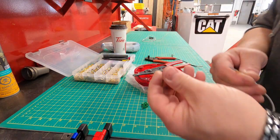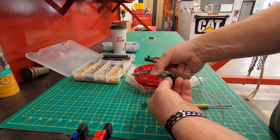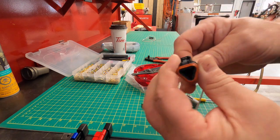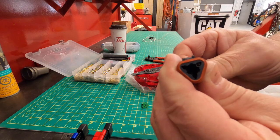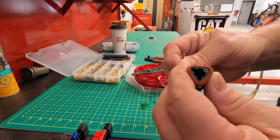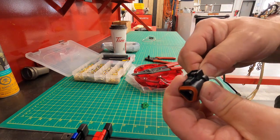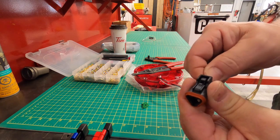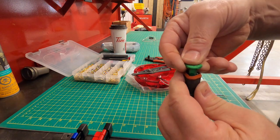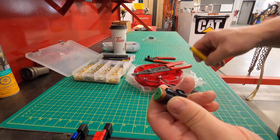To put these together, all you do is find the appropriate pin. It will coordinate these pins to whatever matches here. So the white one goes in this corner — you just push that in until you hear it click. It's locked. Here's one I've done already. The black one is this corner, so push that guy in there and push it in until it clicks. So we're done. After you get all three wires in, you just put the cover on and it snaps on like that. Everything's protected, sealed, zero maintenance.